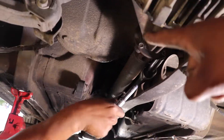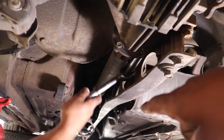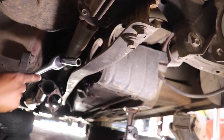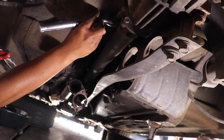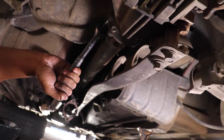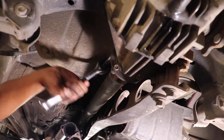All right, let's get back to it. Now we're gonna pull out the drive shaft — it's 14 millimeters, four of them — and they're coming out fairly easy, he's doing it with no problem. They're easy to take off, so let's remove that and I'll pick up the camera once we move on to the next part.